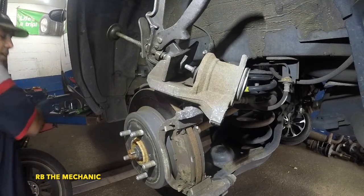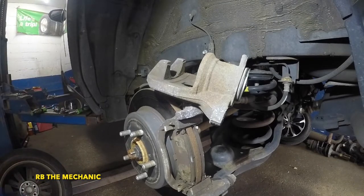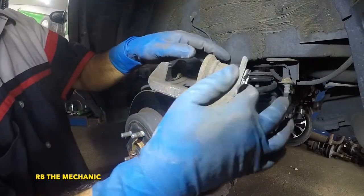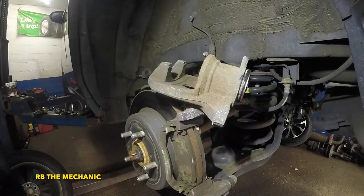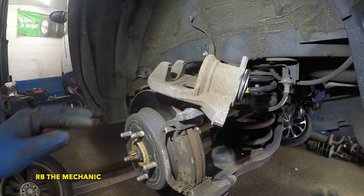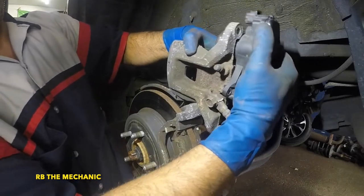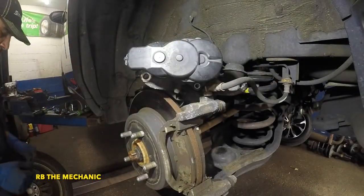From here on, put a little bit of lube on the seal — WD-40 will do, any grease will do. A little bit of lube on that seal again. This is a Lexus but if you've got a Toyota, same procedure — even Range Rover, same way. Now the caliper goes back on like this — remember it was facing up so you might have to maneuver it a bit. Once it's in there it's in there.